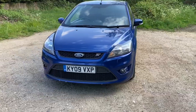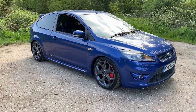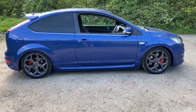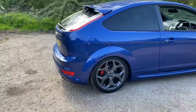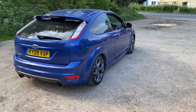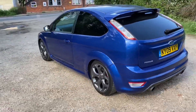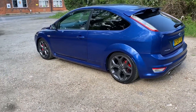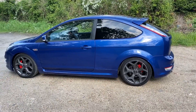Just took it out for a little test drive - it's the first time I've driven it. I got my mate to drive this one when it was dropped off to him. Yeah, really nice - sits really well now. They definitely put the wrong springs on the back. I've got a feeling the front was lowered, the back was standard at some point. They've got a colour code on them - some squares - and they were odd, not even matching rear springs. So whoever sold this tried to keep their springs and just chucked any old springs on. But yeah, sits really really well now.